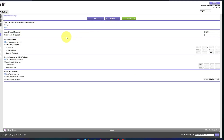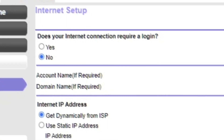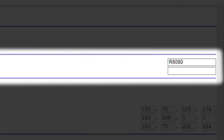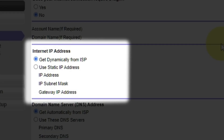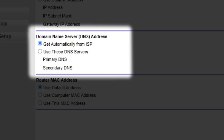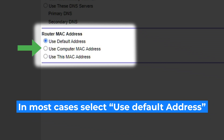Select the internet settings on the next page. In most cases there are two options: connection with and without a login. Almost always, your internet connection will not require a login. You can find all of this information in your internet service provider's contract. If your internet connection does not require a login, or you do not know whether it does, select No. Leave account name and domain name unchanged. In the Internet IP address section, choose Get dynamically from ISP. In the DNS section, select Get automatically from ISP as well. If your ISP only allows internet access to a specific MAC address, you will need to clone the MAC address of the primary computer. If you are unsure about these settings, choose to use the default MAC address.